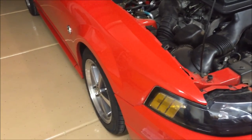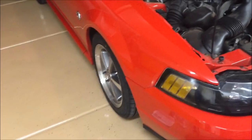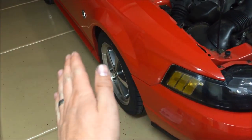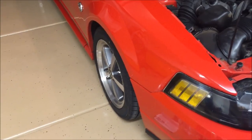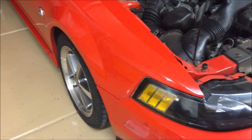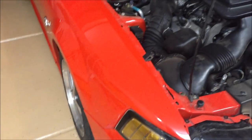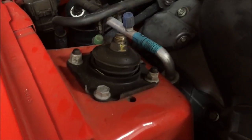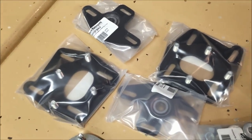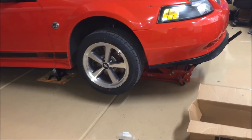The question is why would we install this? When you lower a car it changes the geometry of the suspension. As you look at that wheel it may look a little cockeyed — some of it is normal camber the car is set with from the factory, but once you start lowering it, it changes all that. We're adding these adjustable plates on the strut tower so you can get a proper alignment on the car.